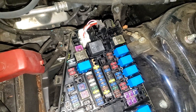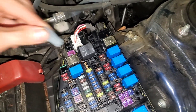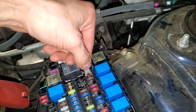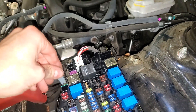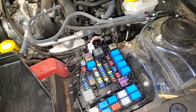As far as the fuse goes, there are two fuses for you to check because this car has two horns. You can find these fuses right here — they're the little 7.5 amp fuses that are right next to the relay. And if you find that one of these is blown, you may want to check the horn itself to see if it's intact and see what's going on with it.